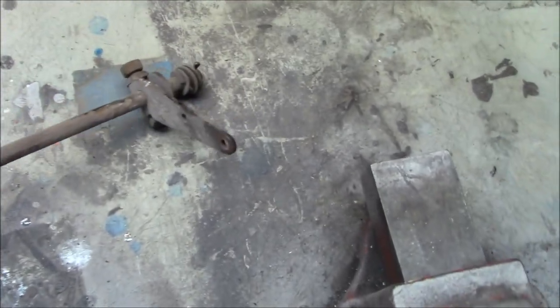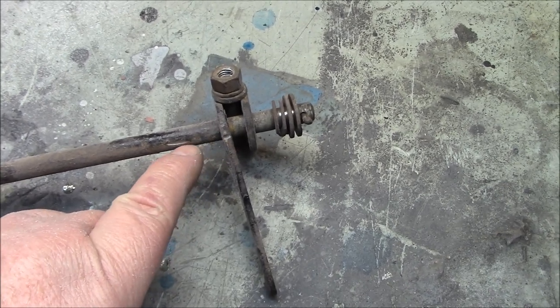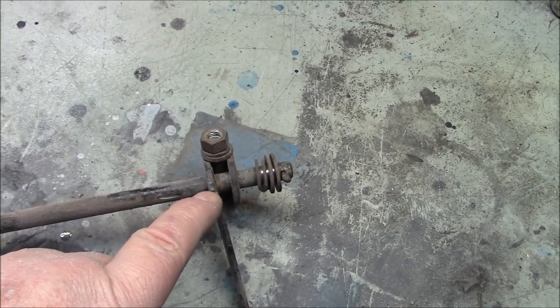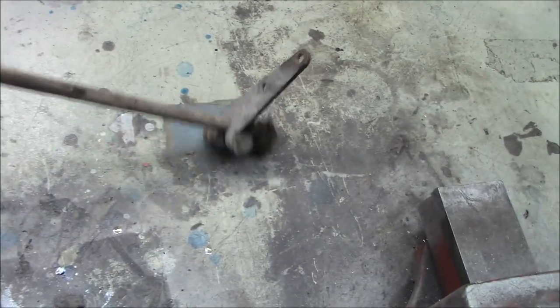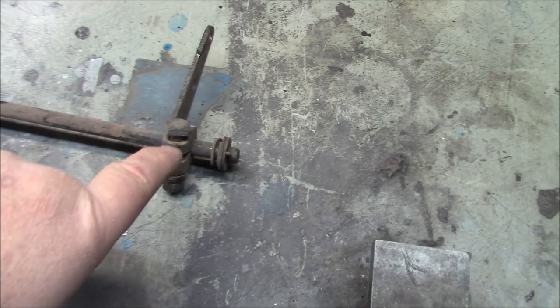One quick note on this little bell crank assembly — I've made a notch and a line in the actual shaft so I can get it aligned back to where it needs to be. I'm going to take this apart to strip and paint it, but I want to get this bell crank back in relatively the same position as it came off. It's a good starting point if you know where it should be relative to how you took it off the car.